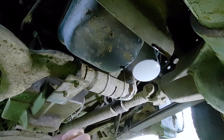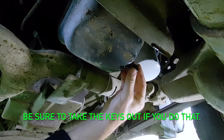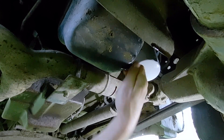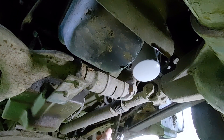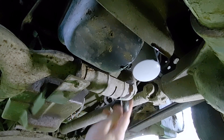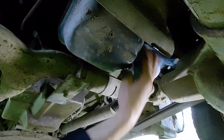We're going to give this another couple of minutes to finish dripping — it's gone to a drip now. If you've got time, let it drip out as long as you can; even go away for a couple hours. We're going to call that good — I'll be changing this oil again pretty quick, I'm just trying to flush out this old oil. Make sure you get your drain plug in straight, don't cross-thread it. I like to just use a wrench so that I don't over-tighten it. You can use a torque wrench — I'll caption the torque spec for this drain plug. It's kind of like tightening a spark plug: you just want to give a good firm pull and that's it. Then wipe off around there and wipe off the oil filter really good, so that after you start it you'll know right away if it's got a leak of any kind.